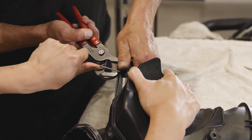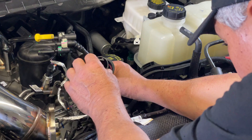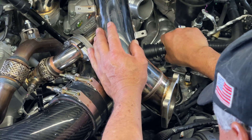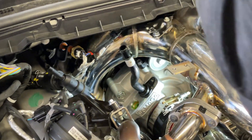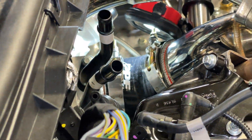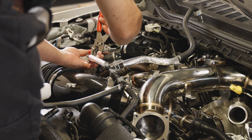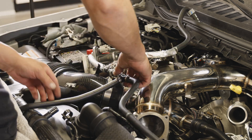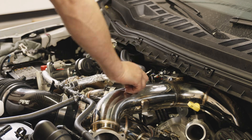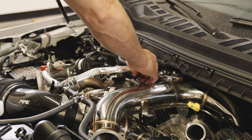Step 24: Remove the O-ring and retainer from the factory turbo inlet CCV port. Push the CCV hose onto the turbo inlet until you hear a click. Step 25, HO only: Reinstall the turbo coolant stand pipes. Reinstall the four-way EGR coolant hose. Secure the hose to the intake manifold side bracket utilizing one of the supplied zip ties.